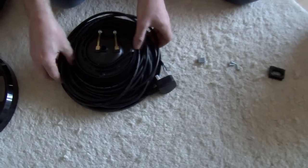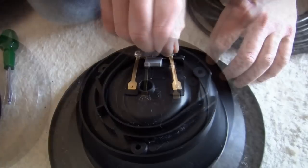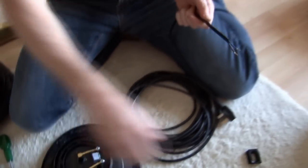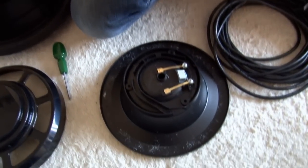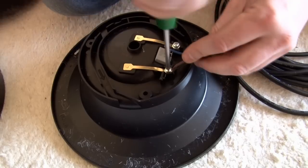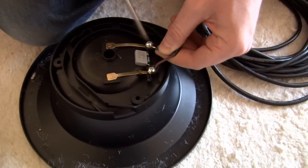Let's start off by putting the capacitor between the two terminals, as we had it on the old one. Now we can attach the cable. You should be able to see that they are labelled live and neutral. But before we do that, do make sure you put the cable entry over the end of the cable and get it the right way round. Let's start with the brown cable going into live and tighten that up, and then blue into the neutral terminal. The cable should come pre-stripped, so it is fairly easy to do.